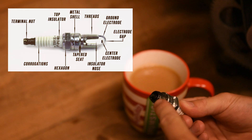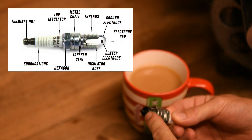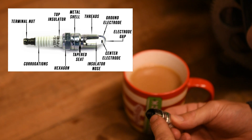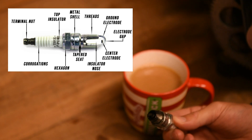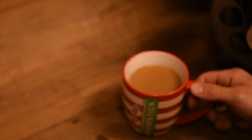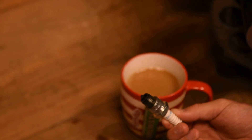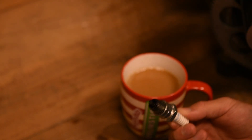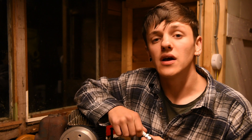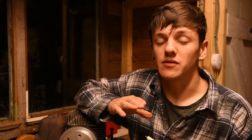What we're looking for is the electrode sleeve — not the little tiny nib bit in there which is called your electrode, but the outer sheath. That should be a cup of tea colour. So that does not match that — this engine is running rich. When you pull your spark plug there are a few different states it could be in. Let's go through them so you know what that could possibly be.